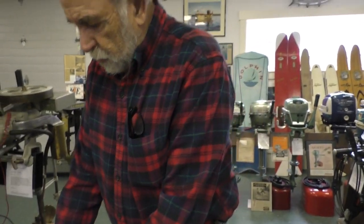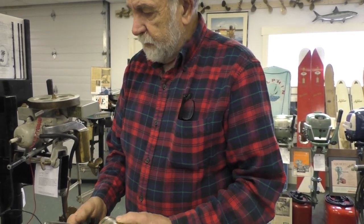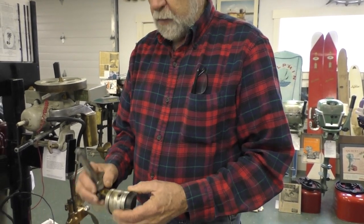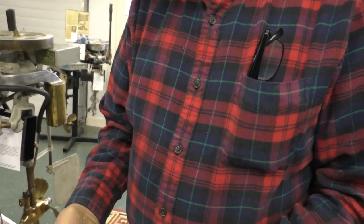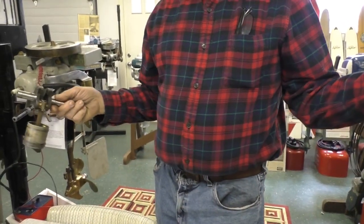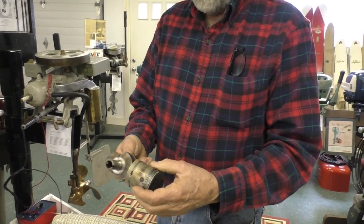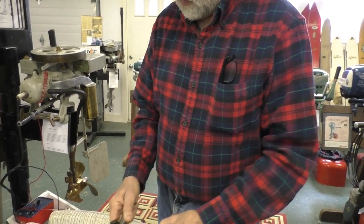It's smooth for a single-cylinder engine. It's remarkably smooth. And that's because of these weights, right? Yep. If you took a modern chainsaw apart, or any modern little single-cylinder engine, a lawnmower engine, they all have this. Right. And prior to Johnson's use of this, nobody had it. This is a major breakthrough, and people don't realize how major.